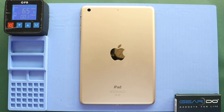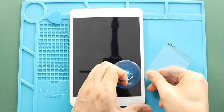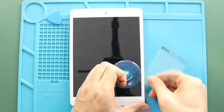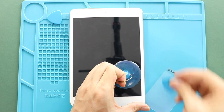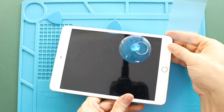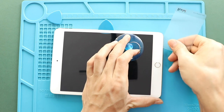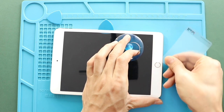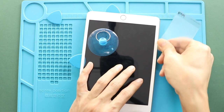Alternatively, you can use a heat gun or something similar. Once the heating has completed, use a suction cup on the side to lift the touchscreen. In between, insert a few plastic pickers or card pry tools and cut the adhesive around.